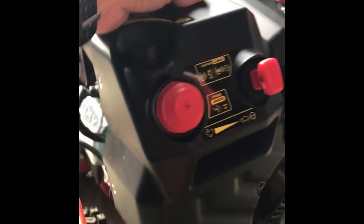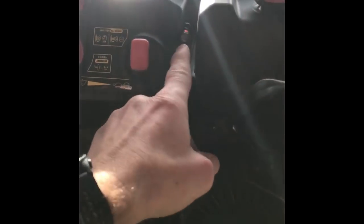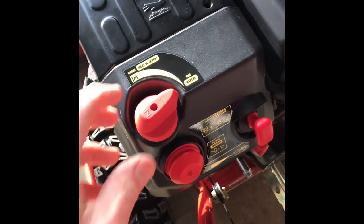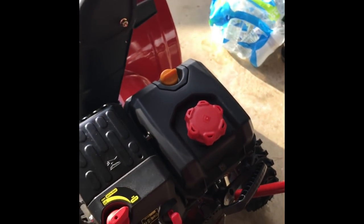All that's left are these four screws and the knob for the case. The top part of the case goes back on and those two wires connect there — doesn't matter which way you connect those. The hose connects there too. There are two screws on this side and two on the other side — one here and one between the gas tank and the cap. It was just those two wires for the starter key; make sure that's in, and then this knob just pushes down on top.